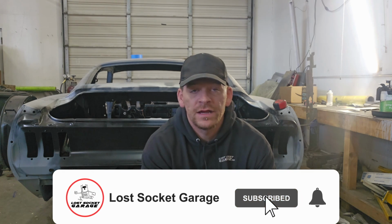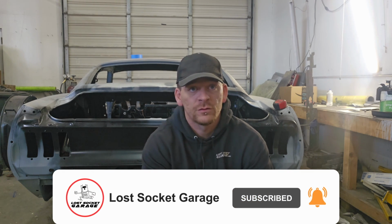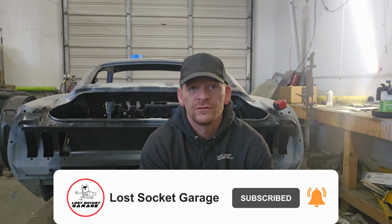Now, I got an interesting question the other day via email or one of the YouTube comments asking if frame rail connectors would help during the actual conversion process, because I have a lot of people reaching out talking about bracing. These are, again, unibody cars, so two sets of frame rails, but nothing connecting them. So when you're cutting a car in half for a conversion, or you're replacing a floor or a roof, or cross supports, etc., you really need to be cognizant of the fact that your car could just buckle. So bracing is very, very important.